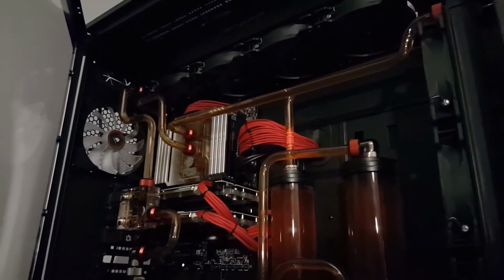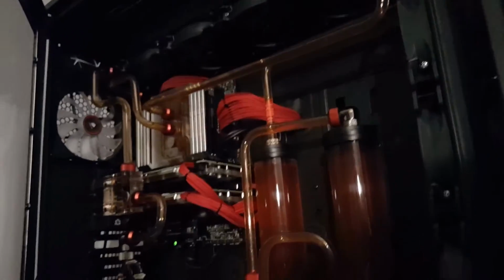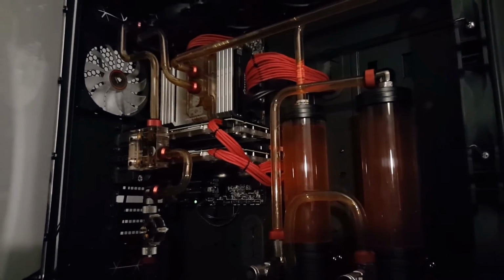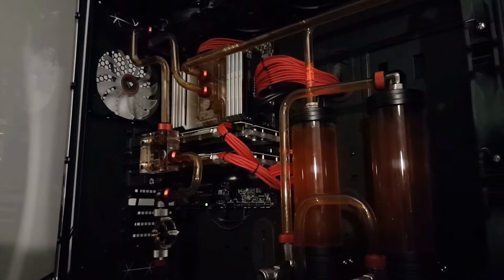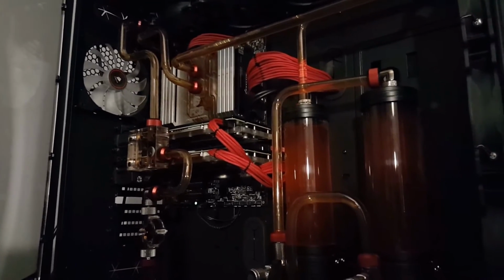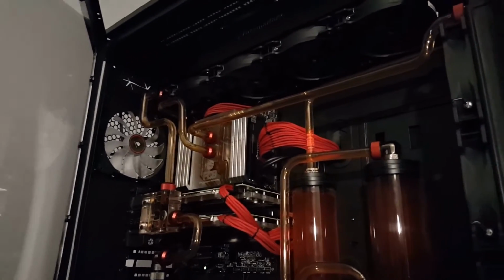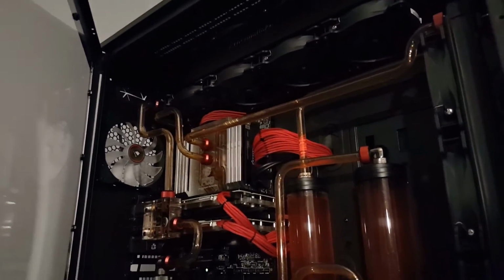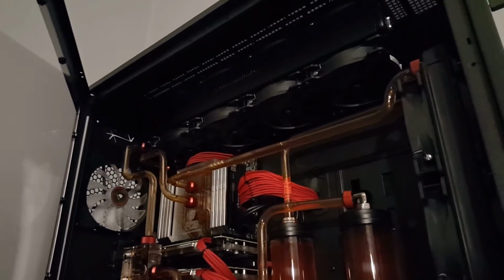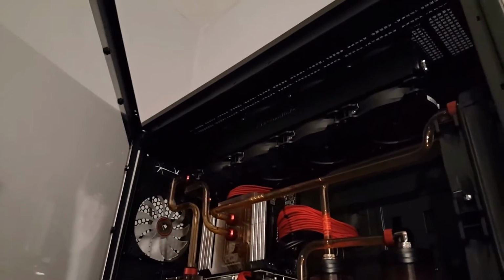So at that time, I didn't do my research, unfortunately. I didn't know that my Thermaltake radiator was an aluminum radiator with a zinc coating. So, a few months ago, I did that, and a few weeks ago, I was talking about it on the forums and realized that when black stuff came out of it, it wasn't because the radiator was dirty. It was the zinc coating. So what I did was basically completely wipe out the zinc coating with the acid bath. So right now that radiator is a full aluminum core radiator with nothing protecting it.